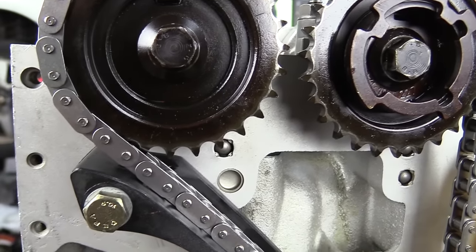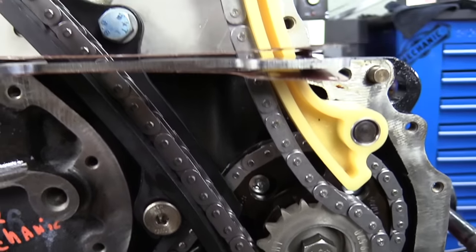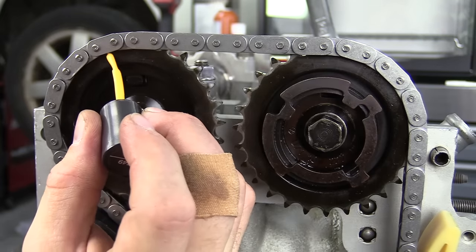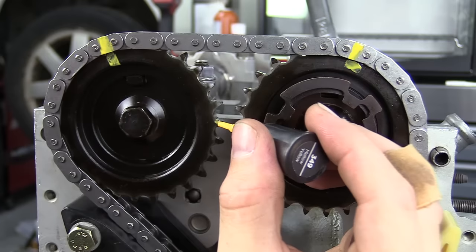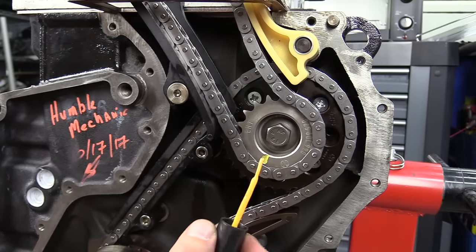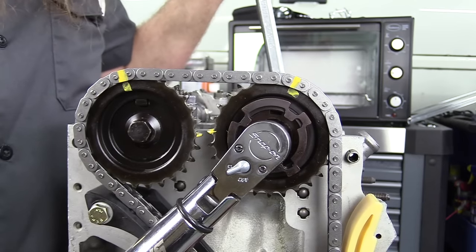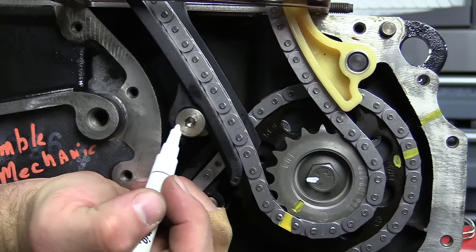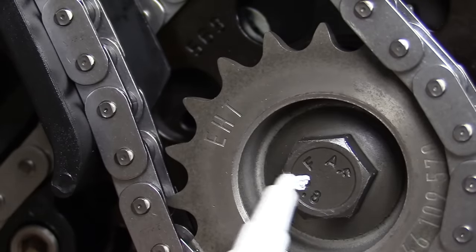Once that's installed and the bolt is snug, our engine is officially timed. Before doing anything else, I like to do a quick quality check: make sure my cam plate is still installed, make sure all of my marks and the factory timing marks still line up, and make sure the slack in the chain is all on the tensioner side. I also added several more yellow marks for three reasons: very quick visibility to be 100% sure everything is timed; for rechecking timing when we go back; and for future video use. Next, torque all of our bolts — make sure you put a torque wrench on every one. I like to add a white paint mark, different from the color of our timing mark, to be sure I got all the bolts. Doing this allowed me to find that I missed one the first time, so I was able to go back and re-torque it.